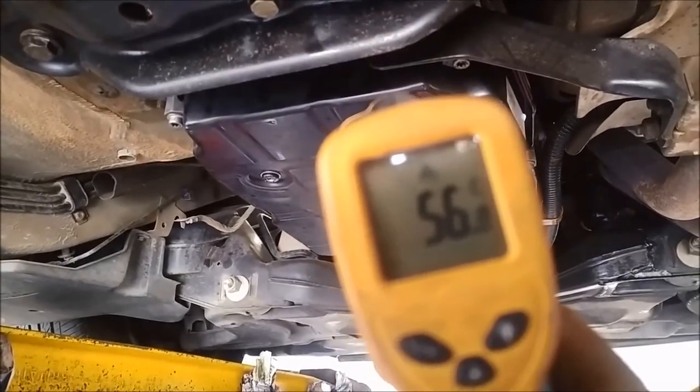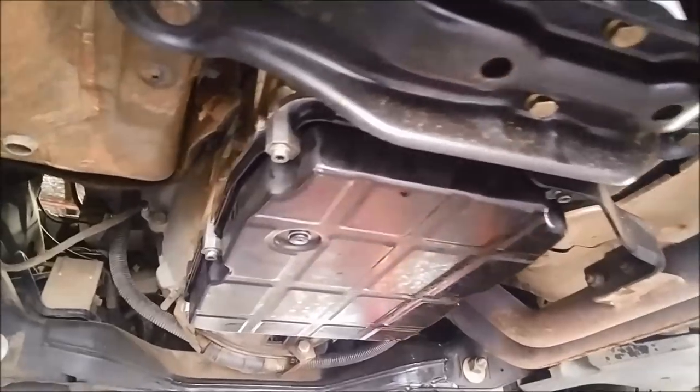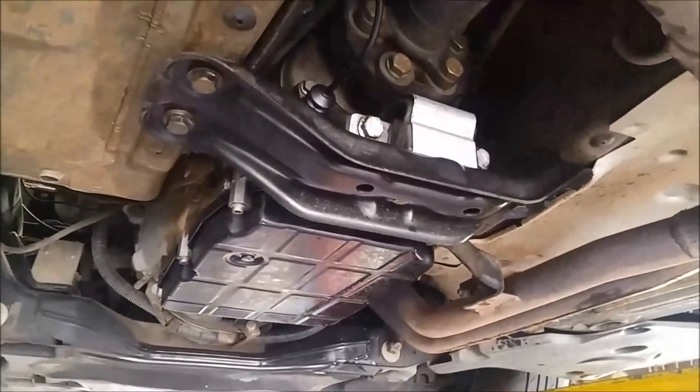We've had it for a bit of a test run. I've left the fluid level not quite up to the top mark where 80 degrees is, but between those two marks. You can see it's not leaking over here — I did spill a bit out of the filler tube, but I'll give that a pressure wash. Just running around double-checking everything looks okay — not leaking at the plug, not leaking at the pan, not leaking at the park interlock or park actuator. Thank you for watching.